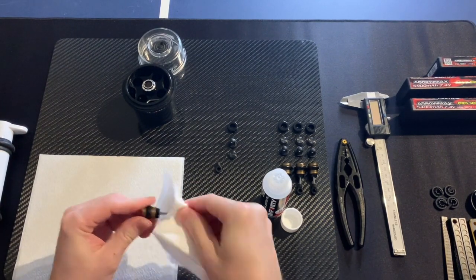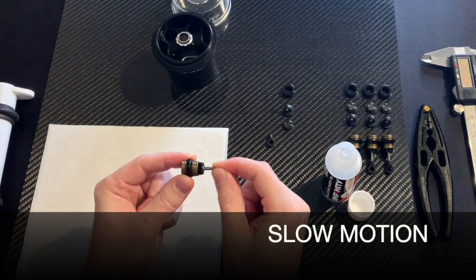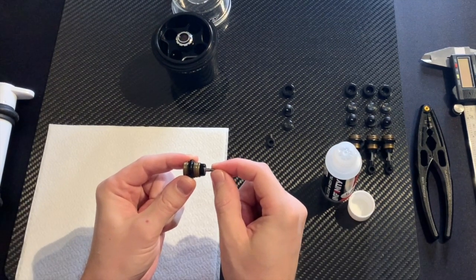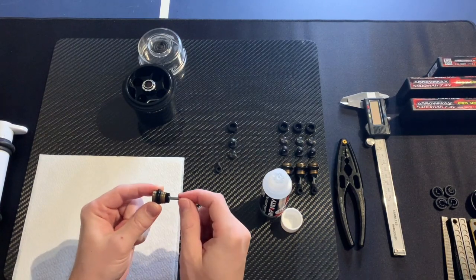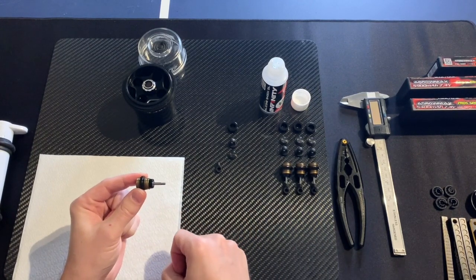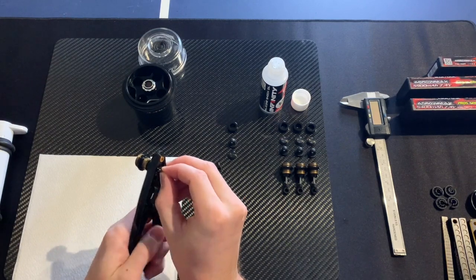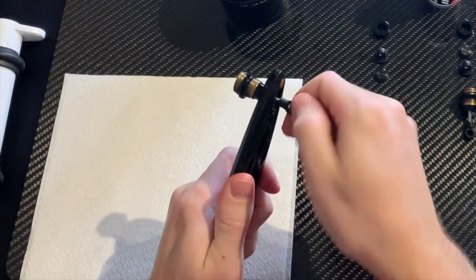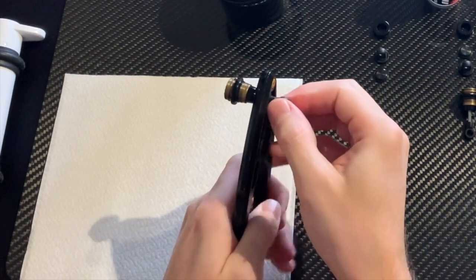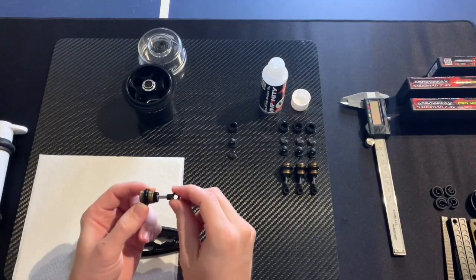Some paper to tie it up. Then I want to make sure this is oil free. You test also the different shocks you have and make sure all the o-rings feel good and free. Take our pliers and screw on. Here it is important not to screw this one in too tight so that you damage the hole for the ball. Make sure it is free.